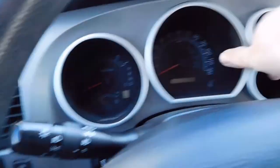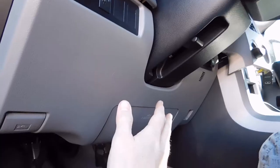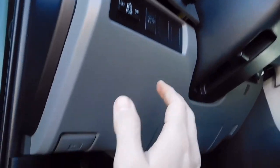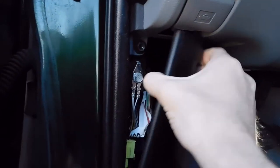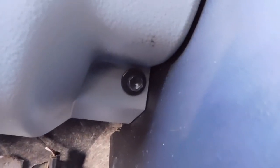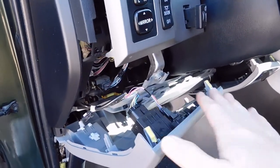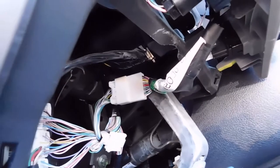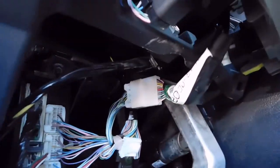There we go — it's all pretty loose. Now that the upper part is loose, we're going to be removing this lower panel. The top of it is just clipped on, and the bottom is held on by 10 millimeter bolts. If you pull this aside you'll see one bolt here and another one right there. Now that we have this dropped down, we can get to what we wanted to see — this connector right here. These are the wires that come up from the side of the cluster bezel, and this is called JL1, I think, if you check the prints for this car.